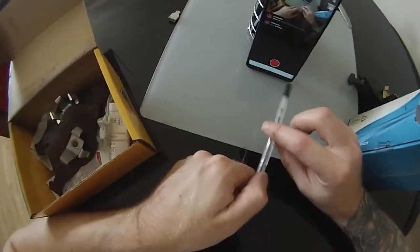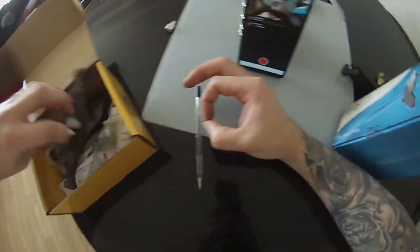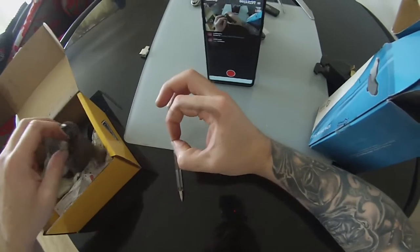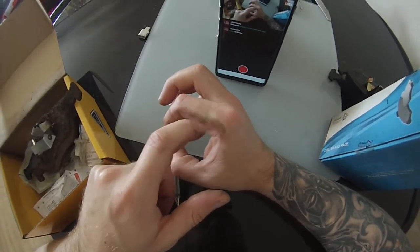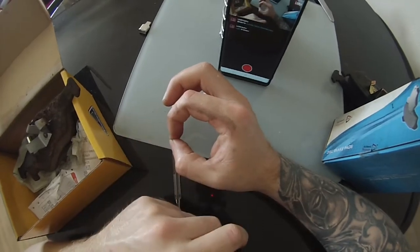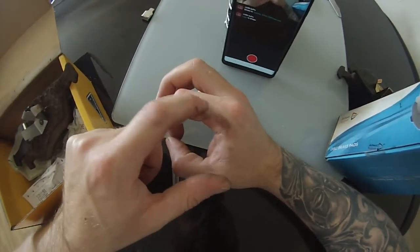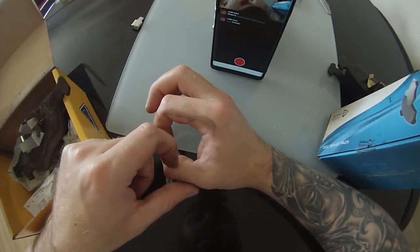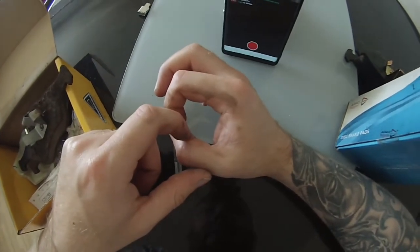One more thing, about the disc. We'll use a circle like this, so that's the disc, very, very small, and the pads are against the disc. As the disc rotates, it can leave a step on the outer edge and the inner edge. So if you're inspecting your disc as well, look out for that. A millimeter, maybe 2 mil is pushing it, is the size of the step on the outer edge and the inner edge. If there's a step greater than 2 mil, I would say that's quite bad. Get that changed. That needs a new disc. I know this is about pads, but that's quite relevant, I think.